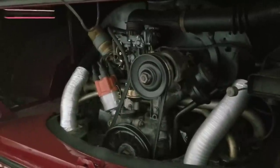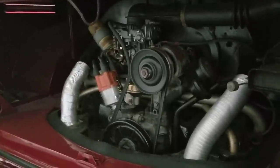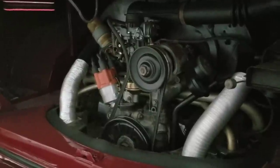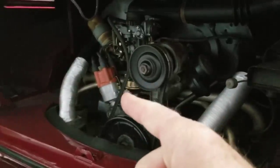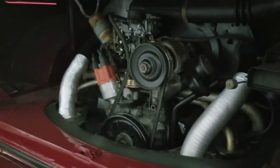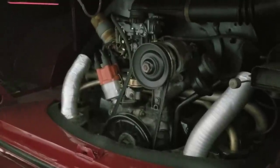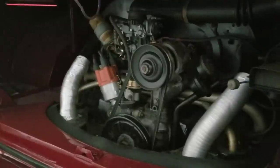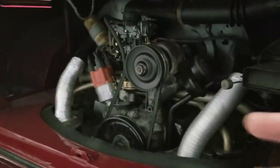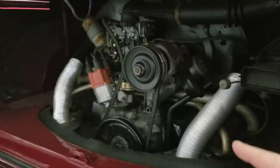If you have adequate cooling — running a doghouse fan shroud and cool tin — that retarding is maybe more than you need. Some guys say the cool tin doesn't work, but it does. I'm not even running a doghouse on this engine and it doesn't run hot because I have the cool tin on there. I also have a really oversized cam, which brings more air and fuel mixture through the heads and can actually make your engine run a little bit cooler.